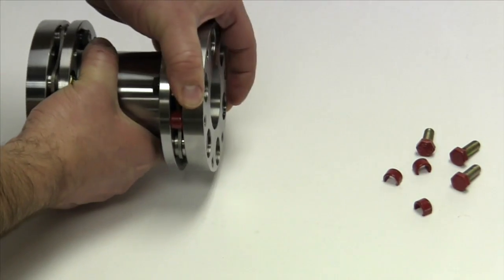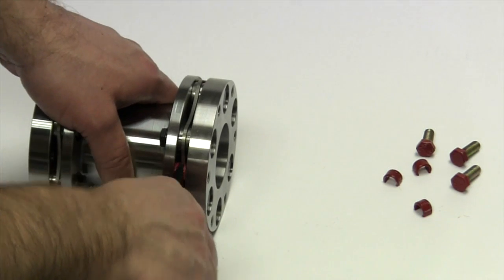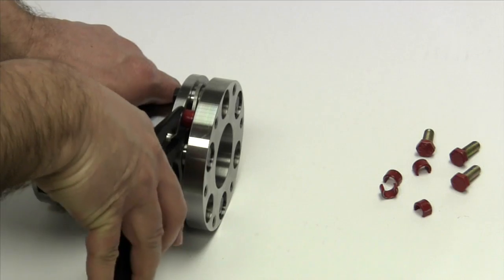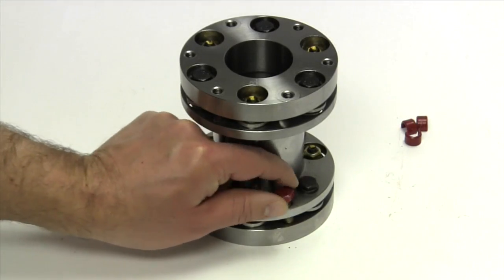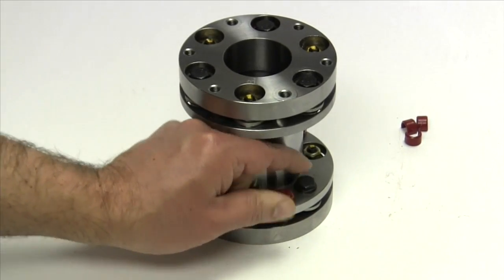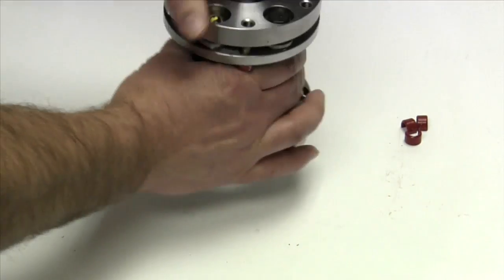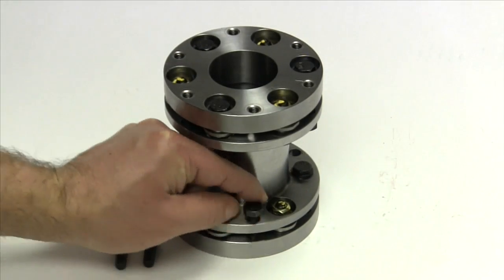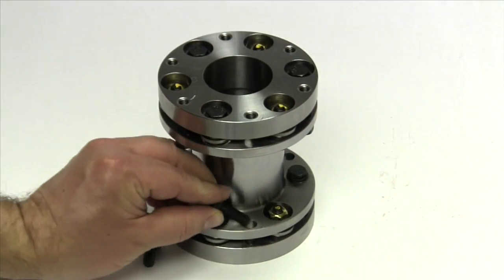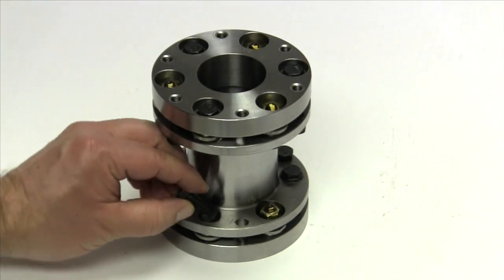With the bolts removed, the sleeves should be loose enough to drop out or easily be removed by hand. If the sleeves remain wedged between the flange and the guard ring, a pair of pliers can be used to remove them. The shipping bolts should then be placed right back in the same holes. If your spacer assembly did not come with shipping bolts, take a few of the hub mounting bolts and place them in the compression bolt holes. Even when hub mounting bolts are used as compression bolts, there will be enough bolts remaining to line up and anchor the spacer assembly to the hubs. Hand tighten these compression bolts until the heads come into contact with the spacer flange.